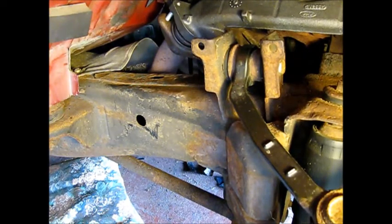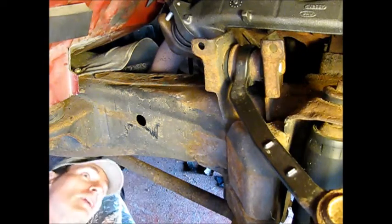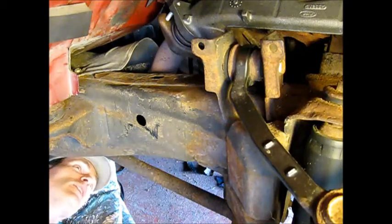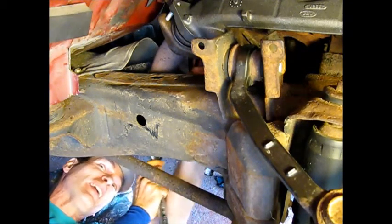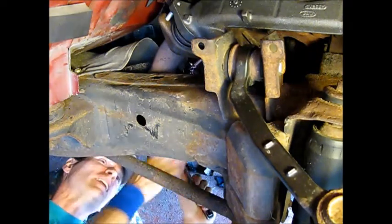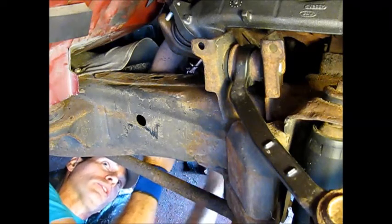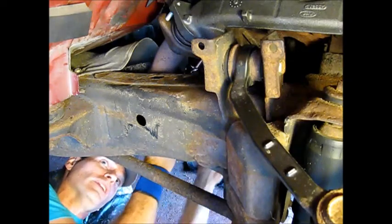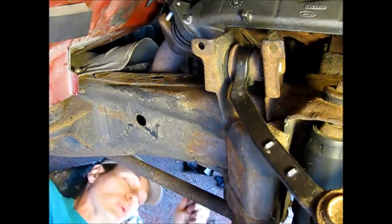The final attachment for this job is to get the flange bolts back on. I've rigged these tools right here — you need a little swivel on here because the nut is a little bit misaligned. This one is supposed to be 25 to 34 foot-pounds. I'll just alternate back and forth, first one side then the other, so it goes on evenly.